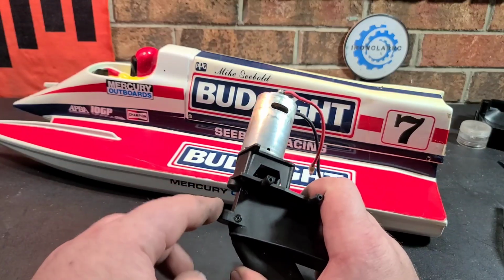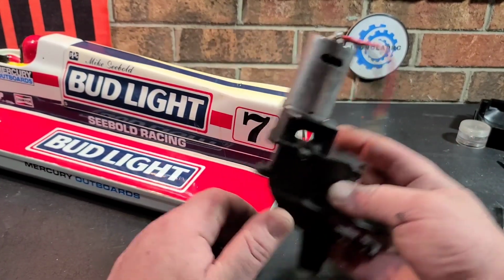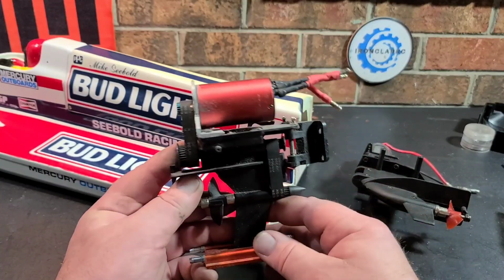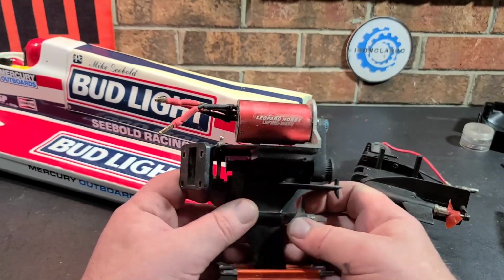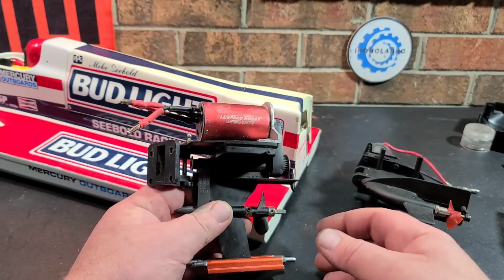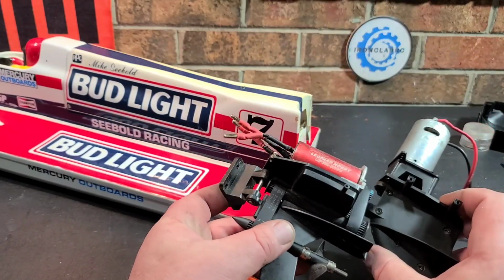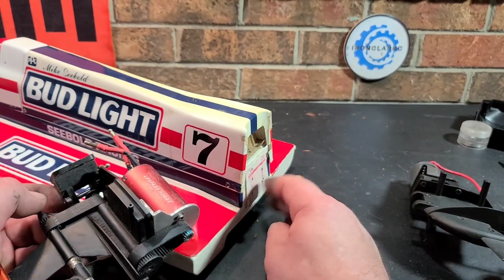And we're going to need to fabricate a bracket to mount the motor up to the transom, because I didn't see one. I've looked all over the place for one. So NorCal sent me this Nitro ABC hobby motor last year. I've never done anything with it. And I made a plate. We converted it to electric and just kind of bench tested it, and that was that. But I'm sitting here looking, and this mount right here may very well work for this motor. Okay, so we might be able to make that work. All right, we might need to reinforce the transom a little bit, fill in some holes or whatnot.